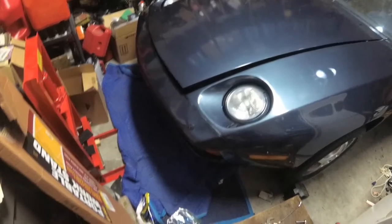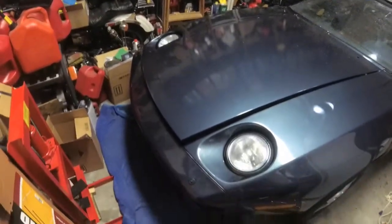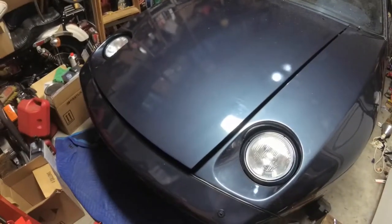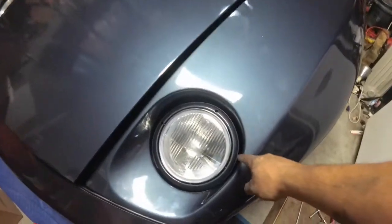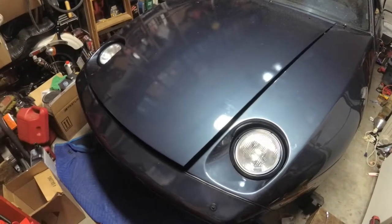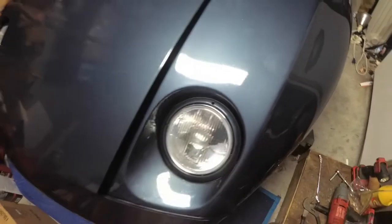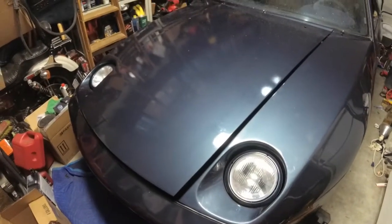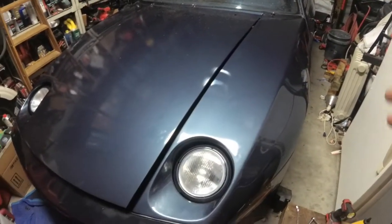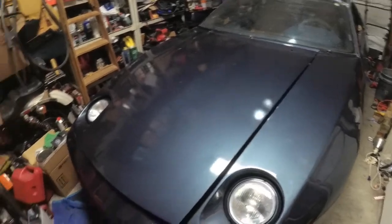Most of the front end is back together. Didn't put the spoiler on yet — I want to wait until I get done polishing the fender and everything. One thing I did different, and I'm curious to see how it looks, is I painted these chrome bezels from the headlights body color, because the chrome kind of stuck out like a sore thumb — nothing else on the car was chrome. I didn't paint the bucket covers because I figured they're in the fender the whole time and wouldn't have faded, but apparently they did some, or the new paint matched to the code doesn't completely match. So I'll probably have to redo those, but I need to get some more paint. I need to put the little bezels on the lights too, so I cleaned them up.